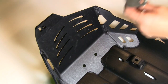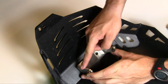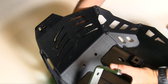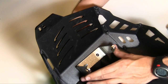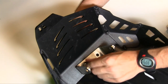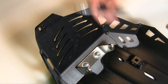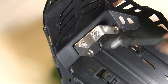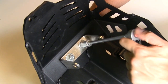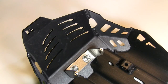Go ahead and grab the stainless steel front mount bracket. We're going to install that on the plate before we line it up and place it on the motor of the bike. The front mount bracket has a slanted edge and a flat edge — the slanted edge should face up, or align the weld nut on the right. Taking the flathead fastener, put it through the front of the skid plate, then stack the washer on top, then the locking nut on top of that, and just finger tighten the locking nut for now. Grab the second flathead fastener and repeat those steps, finger tightening the locking nut. Next, take your 5 millimeter Allen tool, hold the fastener heads on the outside of the plate, and using a 13 millimeter socket with an extension, tighten those locking nuts nearly all the way down — but not fully. Leave just a little bit of play in the front mount bracket so you can line everything up when placing the skid plate onto the motor.